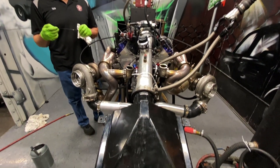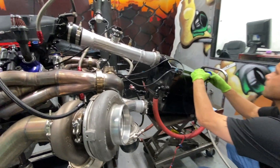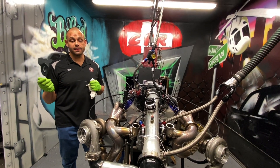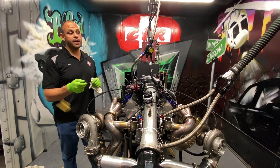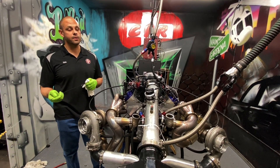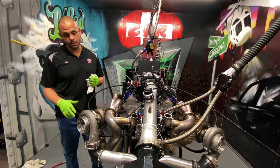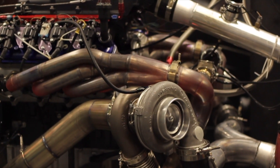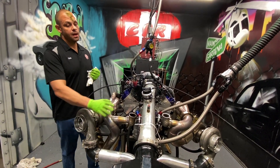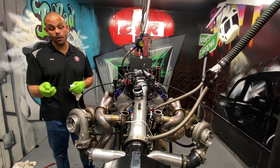The intercooler is keeping intake air temperatures to whatever the water temperature is - we're seeing intake air temperatures at 70 degrees Fahrenheit. The craziest thing was that for the whole duration of the initial dyno hits yesterday, Martin didn't have to get the water on for the intercooler and we were seeing 90-degree intake air temperatures. After all those big power pulls, we came out here and the cold side is actually cool to the touch - just warm - you can put your hand on the compressor housing. I look forward to this in the car.